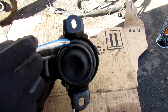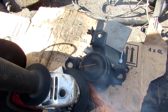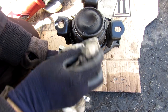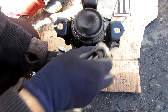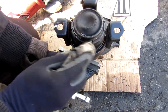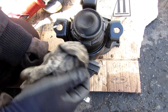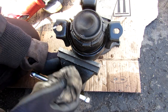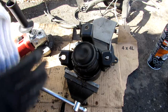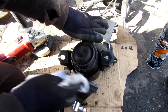I'm going to start by chopping off this lamination around this diaphragm so we can see what's inside. I did not expect that — this is actually a hydraulic mount. You can see if I use a piece of my brother's old t-shirt, some of that oil is actually coming out here. So this is actually filled with hydraulic oil, not just a vacuum controlled mount. Things are going to get a little bit messy here.